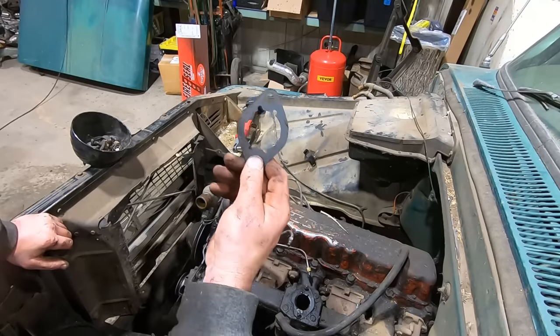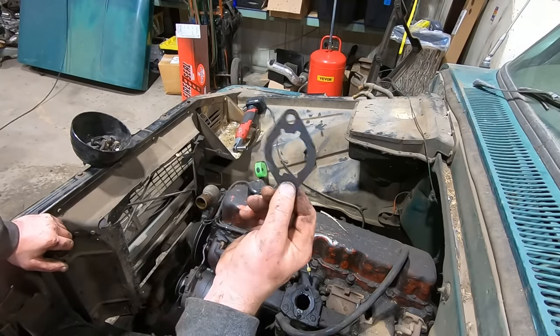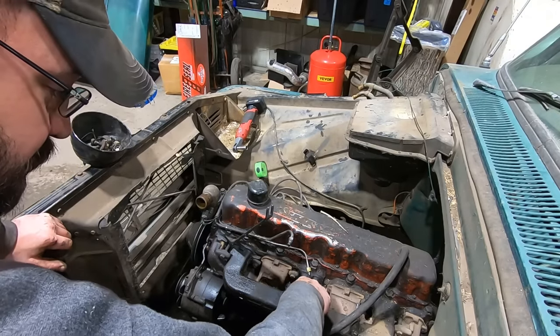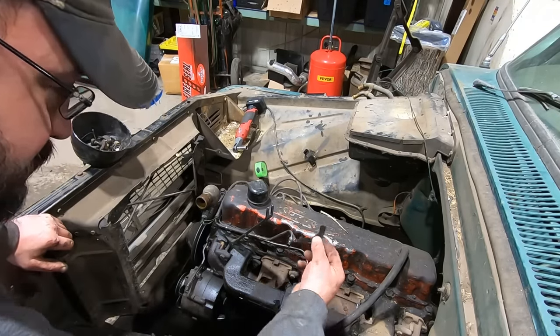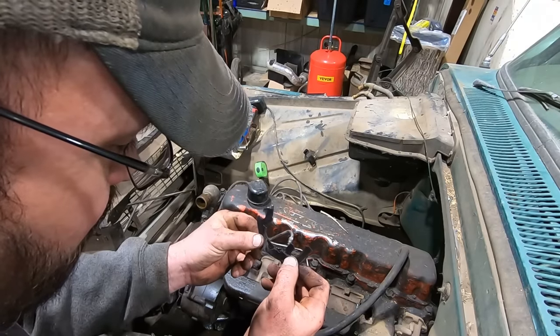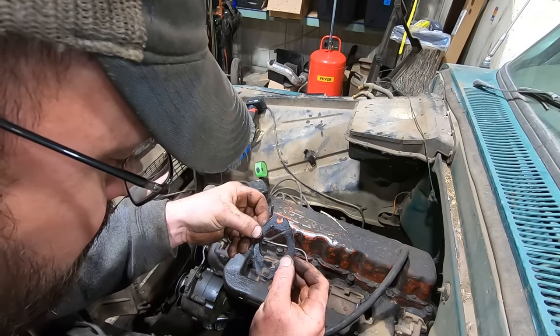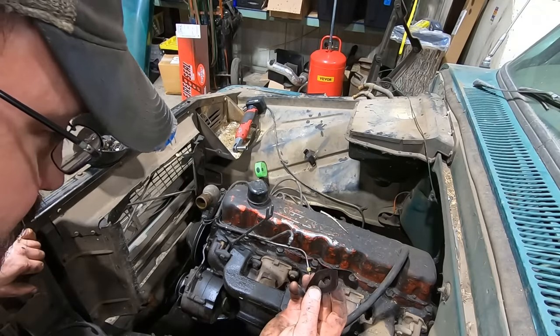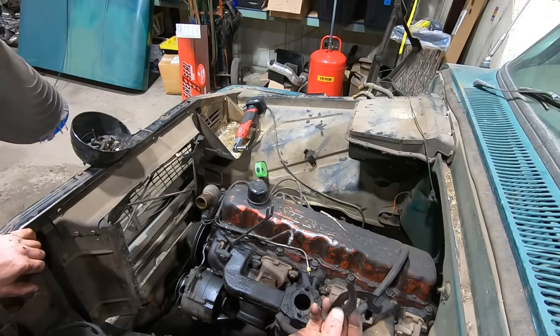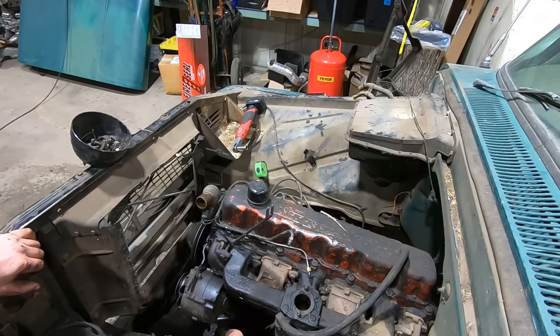So you can tell somebody's been in there recently because that gasket's like new. This might have been why it was idling so high. There's some type of homemade gasket still in there, and she's pretty brittle, plus doubling up gaskets usually creates the leaks, so maybe that was her issue the whole time. Also, that fuel is absolutely putrid.